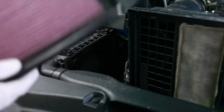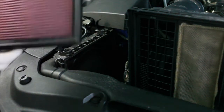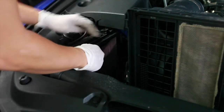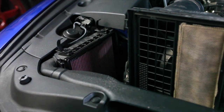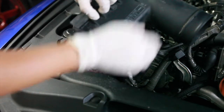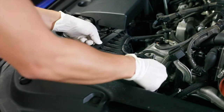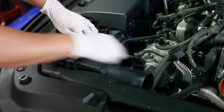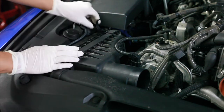We're going to go ahead and reinstall the air filter. The thicker side right here is going to go right into the box — fits in there pretty nicely. Now you want to slowly bring this back and hook it up in place. It should slide into a little seat in the bottom first before you close it on the top. Since mine is securely sitting inside, go ahead and push it in and lock it in place.